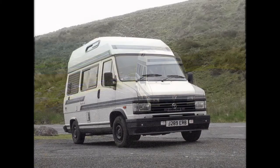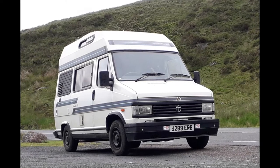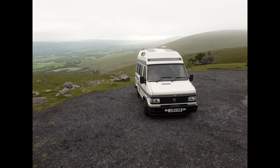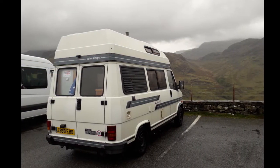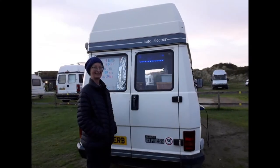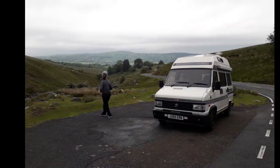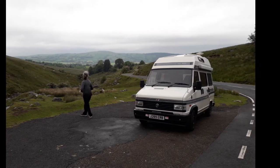When you're in the motorhome sitting comfortably on a chair or in bed, it gets very hot very quickly and gets hotter and hotter until you're absolutely sweating before the thermostat reacts to turn the heater off. That's because the thermostat is in the heater, and when the heater is on the floor it's the coldest part of the van. Because there's only a small amount of air in a 15-foot van, the air heats up very, very quickly.